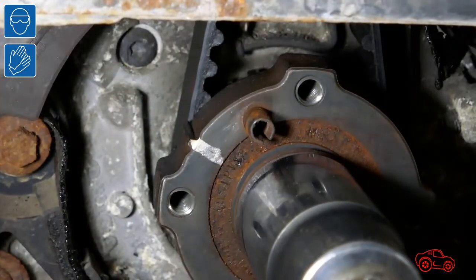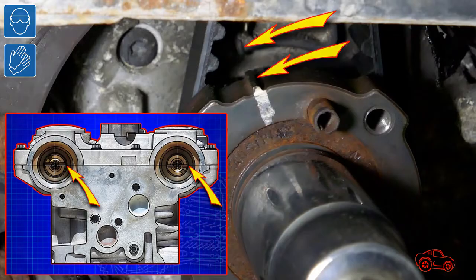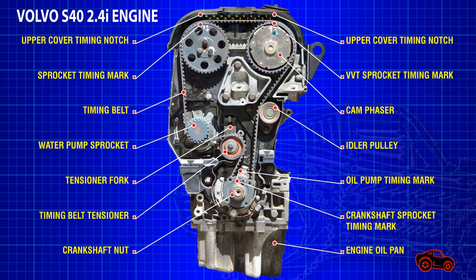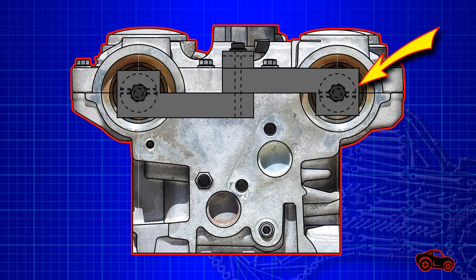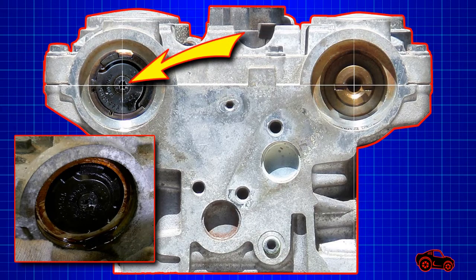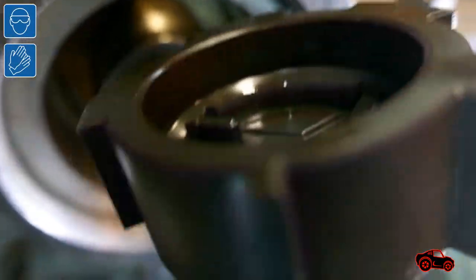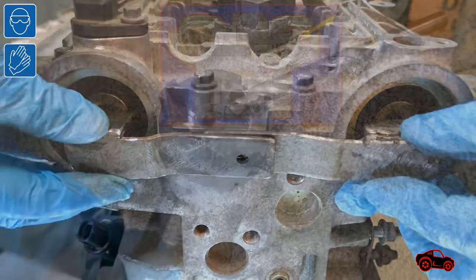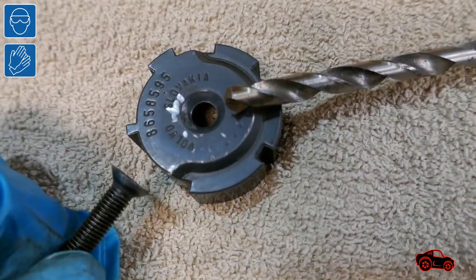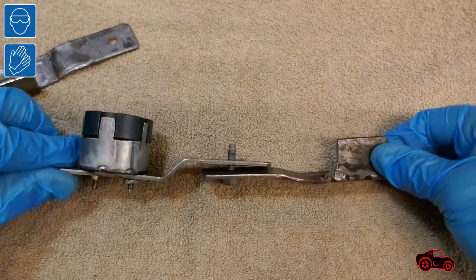While the timing belt was still in place, I rotated the crankshaft clockwise to align the timing marks and the horizontal slots of the camshafts. The first time I replaced this timing belt and the camshaft oil seal on this engine was in 2015. At first I wanted to borrow a locking tool to lock the slotted ends of the camshafts, but when I tried to undo the camshaft sensor wheel screw, I damaged it. Normally when the screw is undone, the cam sensor wheel is removed and then the camshaft can be set to position with the camshaft locking tool. Instead of drilling out the head of the screw, I fabricated a custom locking tool to lock the cam sensor wheel and the camshaft in position.